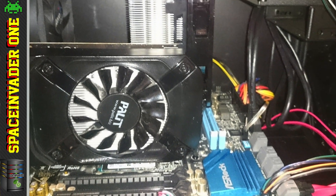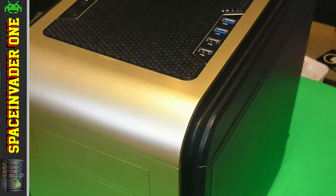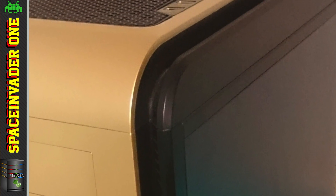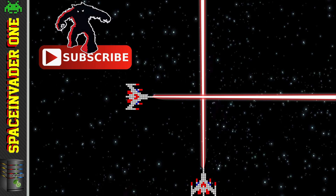That brought me to the end of the hardware part of the build. Inside you can see the two 4TB drives, but we could actually fit another three — one in the included 3.5-inch bay and two more with an adapter in the 5.25-inch bay designed for a CD drive. I powered it on and it's working fine, so now it's time to set up the BIOS correctly and install Unraid — all coming in part 2. If you liked this part please hit the like button, subscribe if you haven't, and I'll catch you in the next video.